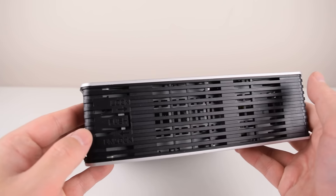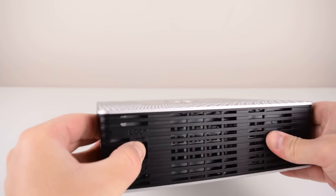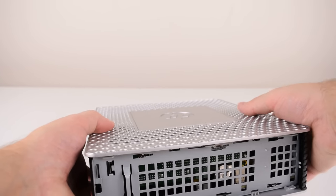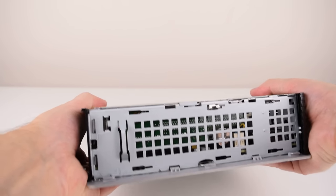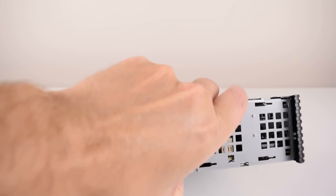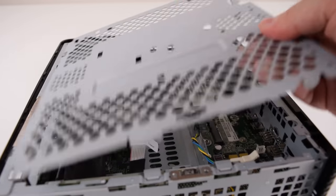So now we're going to open the machine and have a look at what's inside. There's a push button here, just push that down and then this slides to the left. Now we grab the top panel and just push it forward — it comes off just like that — and we can do the same thing with the rear panel. The top is covered with a metal shield; there's a little latch here, just pull it up and off we go.